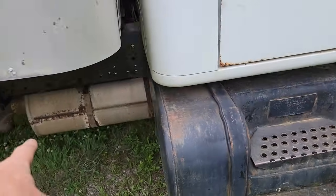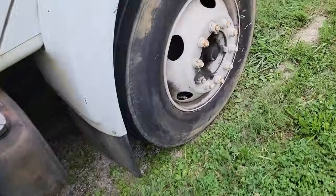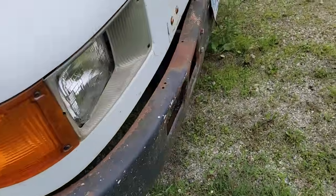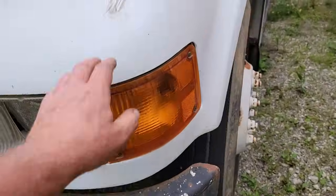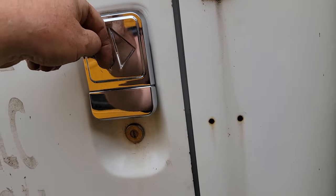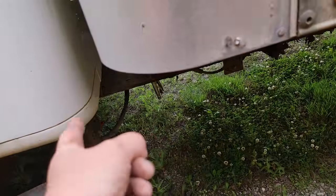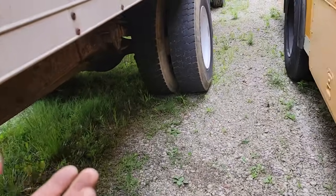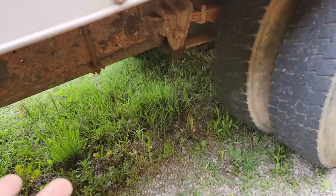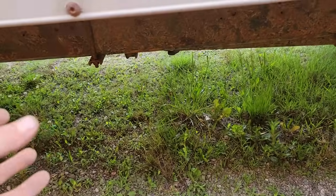There's a little bit of a turndown that's no good on the exhaust — that's kind of weird — but the rest of the exhaust seems to be okay. Front tires are eh, but when we go through it we'll do it all. I have another bumper. The hood looks like it's in pretty good shape, just dirty. It had good batteries in it. This door latch — the locks act up on these where they get locked and you can't open from the outside. I'll fix that, it's not really a big deal. So now I have to do the brake lines, and I didn't just stop and do them even though I had the stuff with me, because we were only a mile and a half from home, and it's counterproductive — when I move the axle forward I'm going to have to cut them back down anyway.